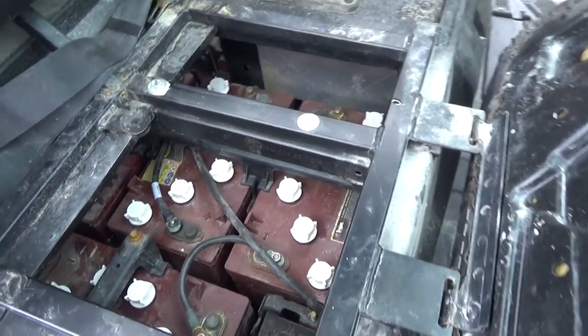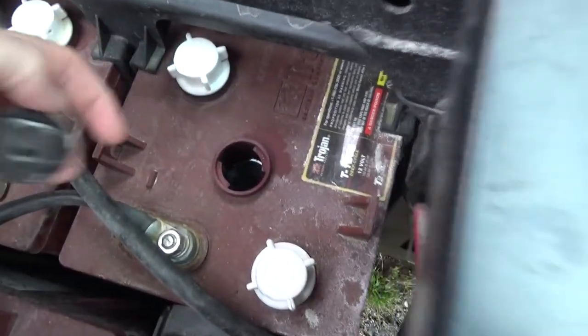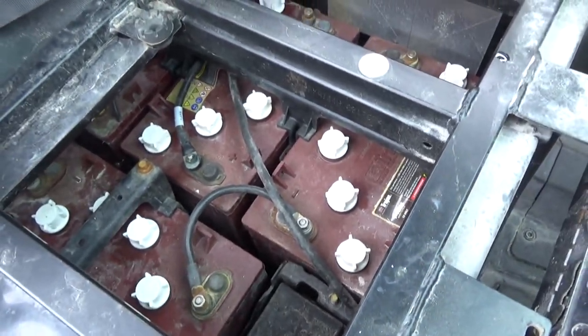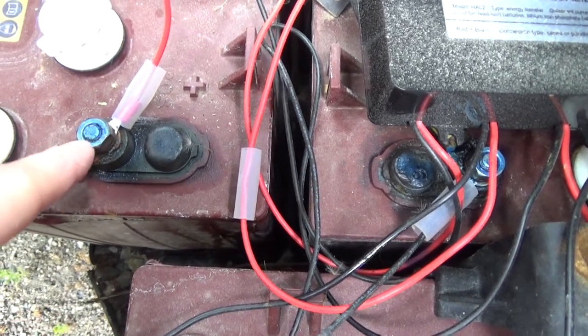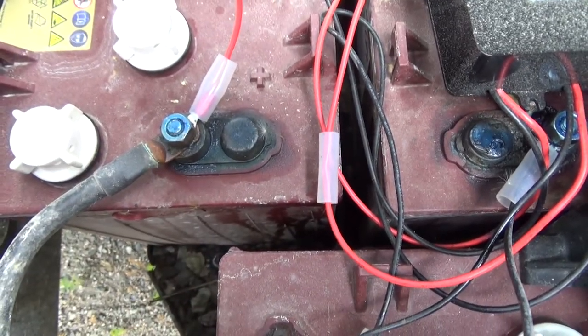Here is a view of the batteries in this UTV — those ones with liquid in them, water-type batteries. They were a bit low on water so I've filled water in them. If I walk over to the other side of the UTV, you can see I've installed one of these equalizers, connected to all the poles. I also brushed up the poles — they were a bit corroded — and I added some blue protection spray on them.